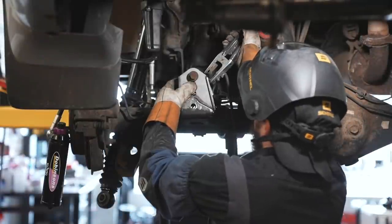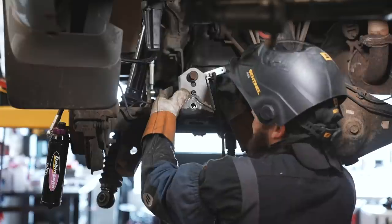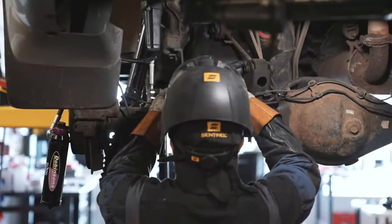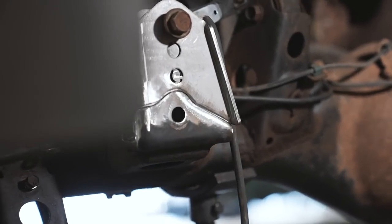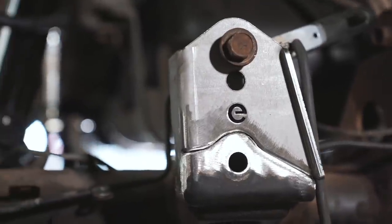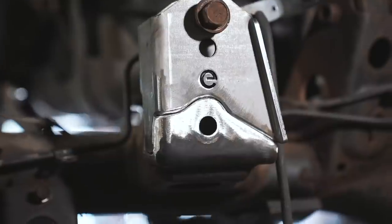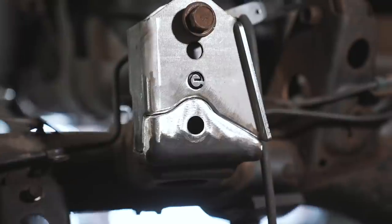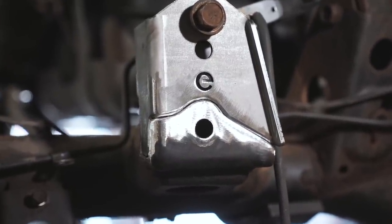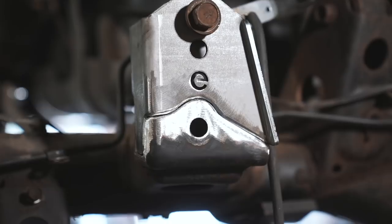What we're going to be doing now is pretty much mocking it up and getting ready to weld. Midge here is our master welder and he's going to get it nice and pretty. What we've done is beveled the corners of the actual kit so that we can lay the beads in there nicely. Because what we've seen on the internet is that it kind of just rolls over and doesn't look super pretty — which is kind of what's on our FJ Cruiser right now. So we are doing it just a little bit different to make it look more like a finished product when it's done.